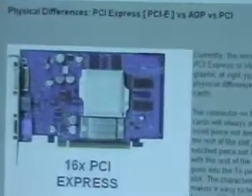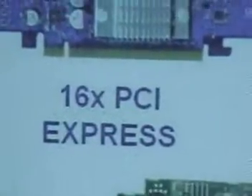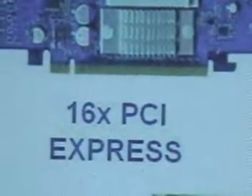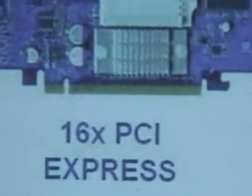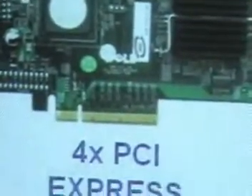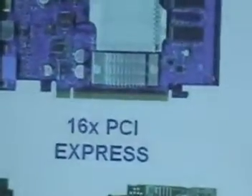So what is the difference between AGP and PCI Express? Well, here you go — notice the bottoms right here. This is PCI Express. Check the bottom of your own card after you shut down and look at this; notice that difference. Now we'll move down — that's a 16x PCI Express. Move down to another one and notice the difference in width.